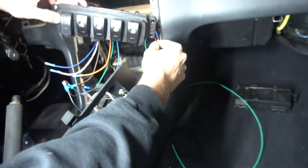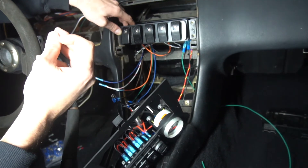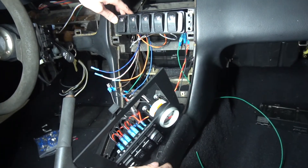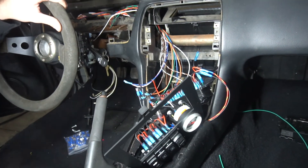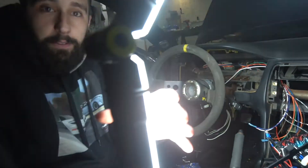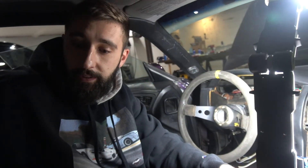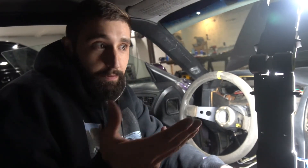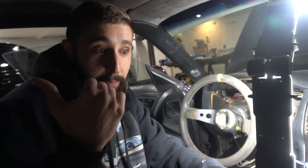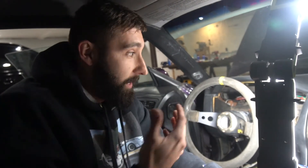I have another wire down here with 12 volts because I had an extra spot — that one I'm going to wire up to the alternator remote wire to tell it to charge, since this is a daily driver. That's pretty much it for the wiring on the switch side to the panel. From here I'll wire in the Holley and do all that, which runs directly to the battery. This setup can be used in pretty much any vehicle — doesn't have to be a 240. We did the same thing on the burnout truck and we're going to do it on your truck and the '67 too.